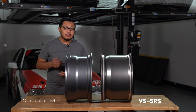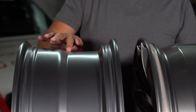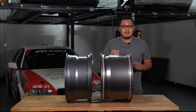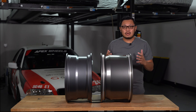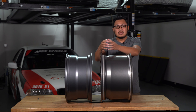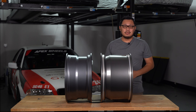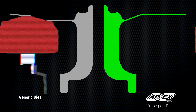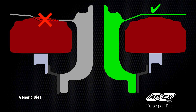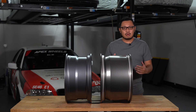Here's a competitor's forged wheel sold for motorsport use that's made from an off-the-shelf forging blank designed by overseas engineers — as a result, the drop center is in the weirdest place and goes back unnecessarily far, which blocks many calipers from fitting underneath. In comparison, our Sprint Line wheels feature a high-clearance drop center that starts as early as possible, which is critical for clearing brakes on applications such as Porsche, Corvette, VW, and many others where the calipers are extra close to the face of the wheel. Additionally, we've eliminated the taper of the barrel, reaching maximum barrel diameter as early as possible. The extra few millimeters from the zero-degree draft allows us to fit more big brake kits and gives existing fitments more breathing room to avoid rocks and debris scraping your calipers.